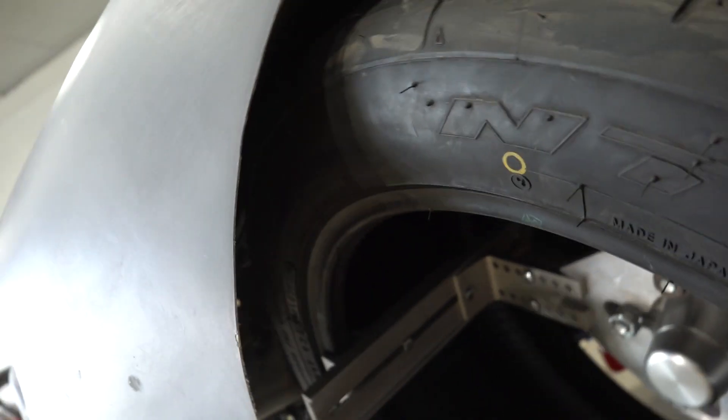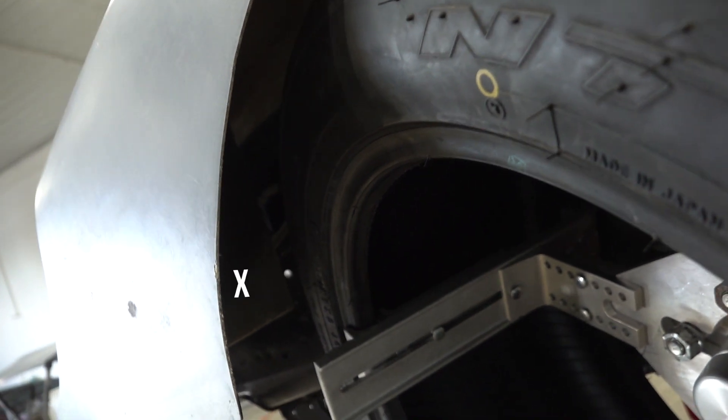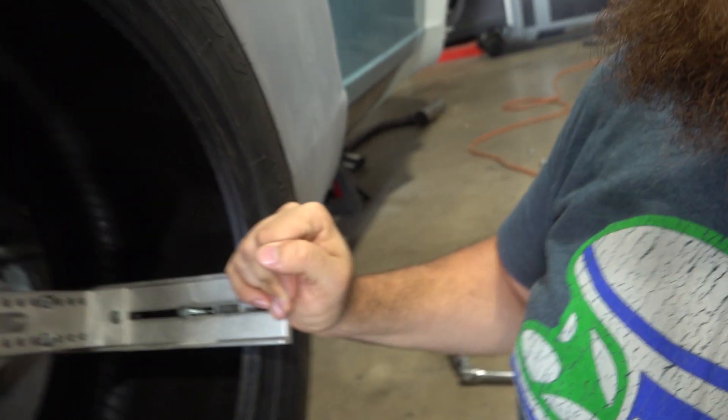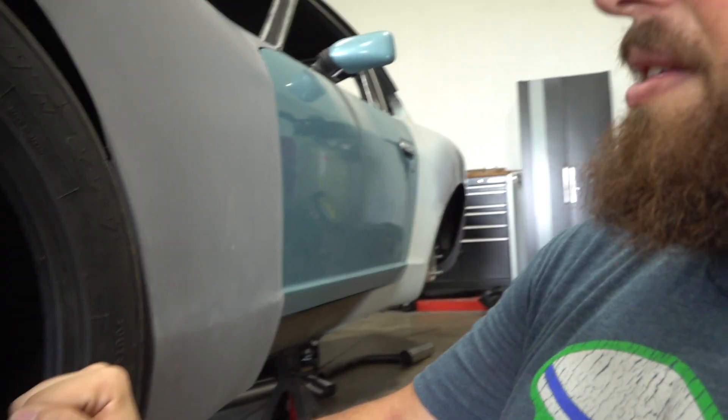Turning the wheel, you can see this is going to be the piece of fiberglass where the headlight bucket rests against, and when I actually install the headlight bucket there it gets really close. And then also, this piece of metal here is getting really close to the tire if I do anything more to increase the scrub radius. So I think this is about as aggressive as I can get. I am going to have to trim this fender — this tire is a little bit taller than this fender was ever really designed for, and there's a whole lot of tire sticking out. Please let me know if I've done something horribly wrong before we have the video of me chopping these two pieces.